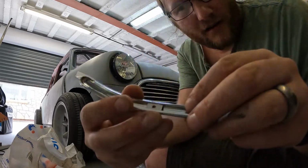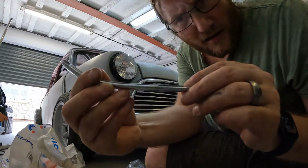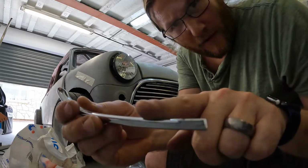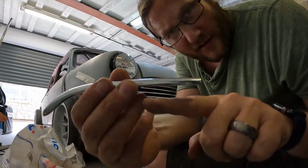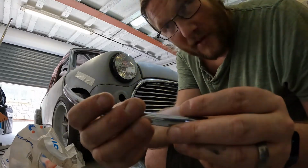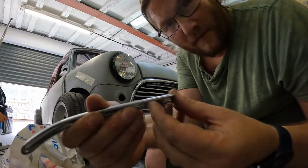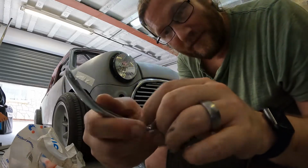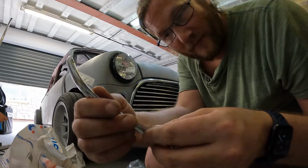So they slide in. Just seeing here, I'll have to put a washer or something behind, because if that's flat, it needs a washer behind to give it a bit of height, if that makes sense. So if that's your car, it needs a tiny gap between, just to be able to slide it on. So I'll have to remember to do that in a second, but need to try and get these in line, drill the holes. I'm going to go for the riv nuts again. I think it just makes sense, especially for this project. Taking things on and off just makes perfect sense. So let's mark these up, drill the holes, go from there.